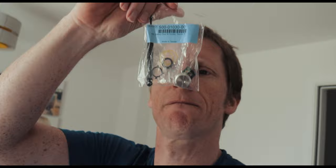So then, yeah, today, as I say, we're doing a little bit of bike prep. So we have our Vector 3 pedals which need to be fixed. There's an error apparently inside the casing which holds the battery. So Garmin have sent us a couple of kits. So we need to get the pedals off, get the spindles out, and replace those little bits. And hopefully that fixes the problem. So let's crack on. Let's get the pedals off.